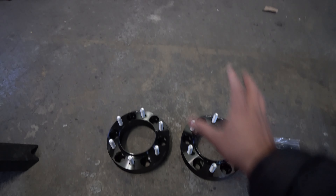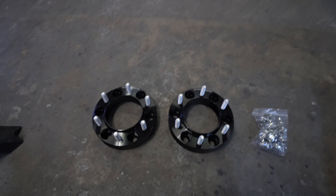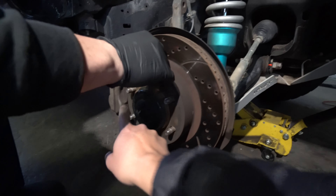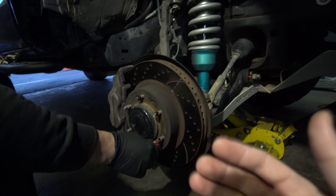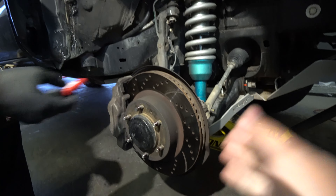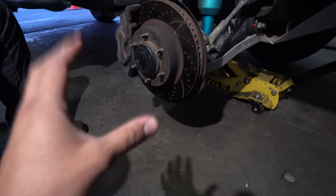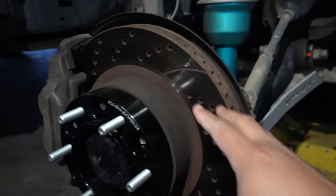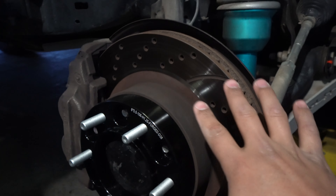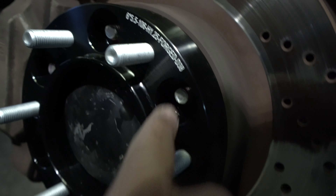I wouldn't just install them without Loctite. Another thing - if you guys don't really need to run spacers, we recommend probably not doing it, especially if you do some hardcore off-roading. The first step is you're going to want to Loctite each and every one of these lugs - there should be six on the Tacoma. If you are installing wheel spacers it's only if you need it; if you do not need it we don't recommend it, but if you do, Loctite is the way to go. Over time, especially after going off-road, make sure these haven't gotten loose. We are going to torque them down but you want to make sure they do not get loose. I'd recommend only going 1.25 inch and downwards - do not go anything bigger. Anything bigger is going to end up probably cracking your studs because it pushes out so much that it's barely going to grab the lugs.